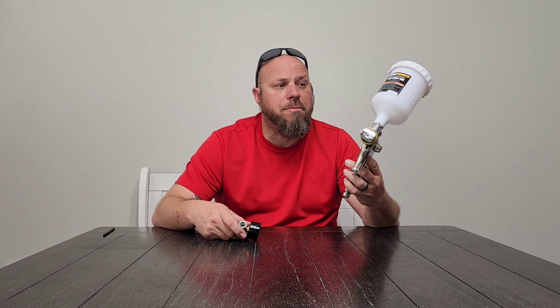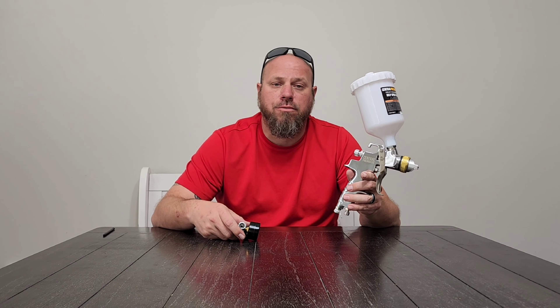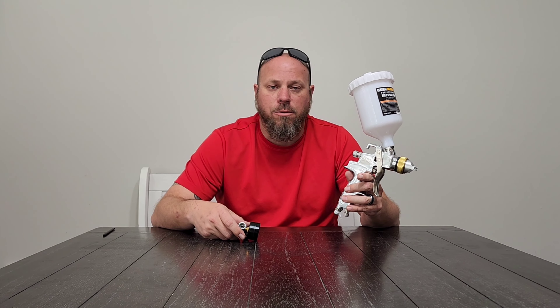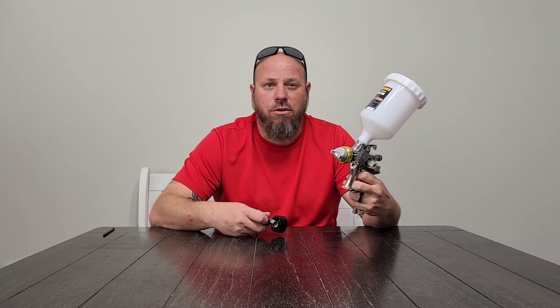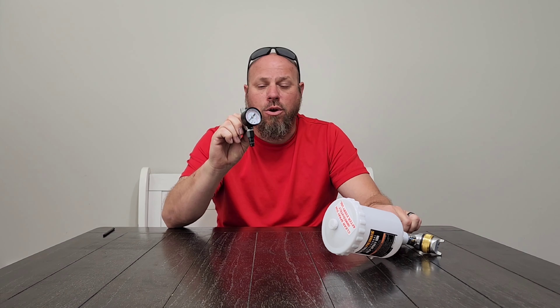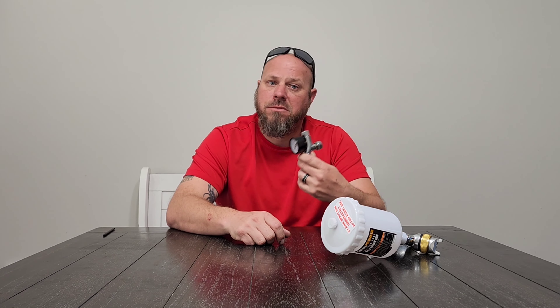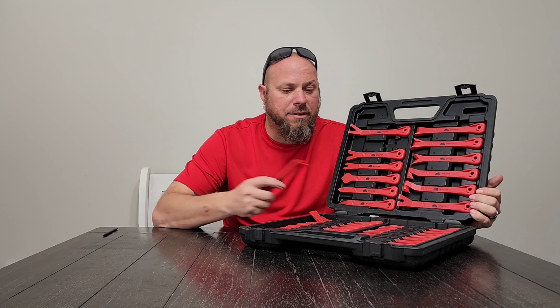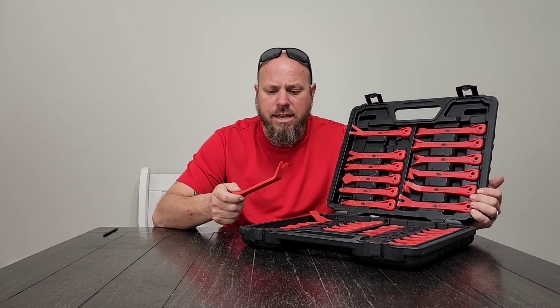What's up guys, Eek with East Coast Ken here for Tech's Talking Shop. Today I'm talking about tools specific to the auto body field. First up are putty spreaders, used to mix Bondo, glazing putty, or kitty hair fiberglass material on a mixing board. You put a little on, add some hardener, mix it around, and then spread it on a vehicle panel, boat, or whatever fiberglass work you're doing.